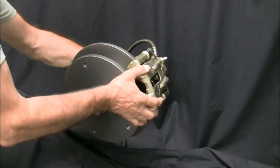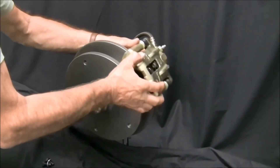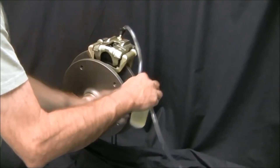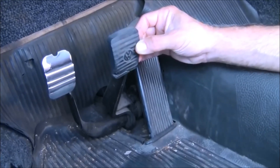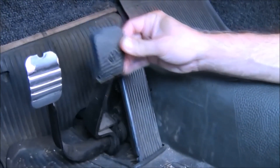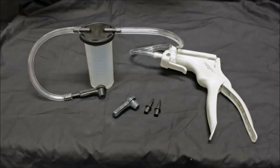Unlike the simple drum brake cylinder, the disc brake caliper design can allow for air to be trapped. To help all the air be evacuated, unbolt your caliper and rotate it up to about the 11 or 12 o'clock position. If your brake line is long enough, just keep it centered on the rotor; if not, you will need a block of wood the approximate thickness of a rotor to be put between the pads. Never apply fluid pressure to a caliper without limiting the pad movement, or you'll blow the piston out of the caliper. Bleed all four corners, then check that you have a firm pedal and that the pedal actuates the brakes at the top of its motion past the pushrod free play, and does not have significant take-up distance. If the pedal goes down part way before brakes function, or if you have to pump the pedal to get it firm, go back and repeat the bleeding procedure — you still have air in the lines. Be prepared to repeat the bleeding procedure, probably a few times, to get all the air out.